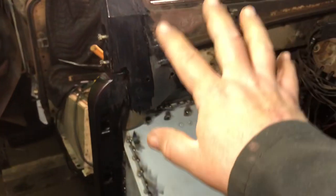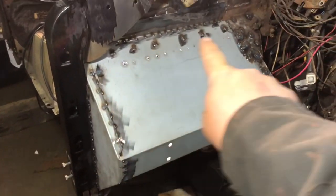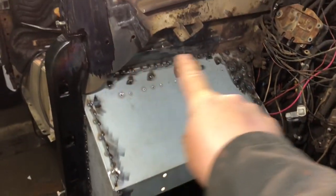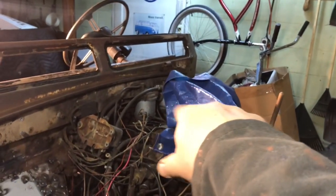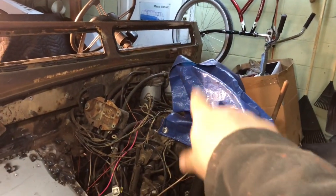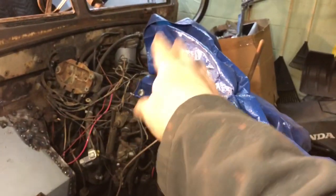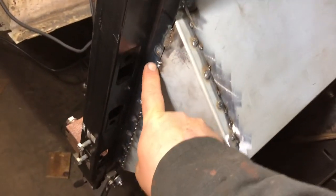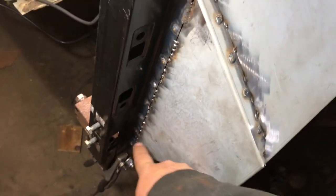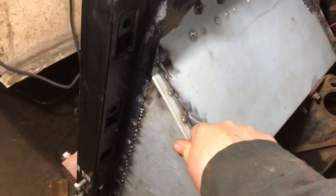So this side is officially done. I'm going to put some seam sealer on all the seams, just so we don't get wet feet. But this side is completely done. I'm going to do the other side. I'll probably just show it whenever it's finished in the next video, because it's not much different than this, besides you have your foot pedal holes. But anyways, also down here I did plug welds, and then I did my little welds here just to make sure it doesn't go anywhere.